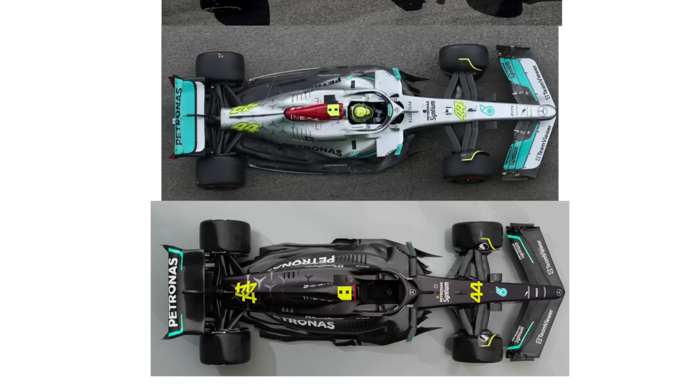So if it's not porpoising, then why is Mercedes fattening out their side pod here? My theory is that it would be for purely aerodynamic reasons. If you imagine that we have a wake off the front tyre and we push it out with all our devices at the front — pushing it out here — that wake will eventually work its way backwards and it will get drawn in if you draw the bodywork in. If we have the wake out here and we pull in the bodywork in this region, we've reduced the amount of volume that's holding the wake out and this will pull the wake trajectory in. So by holding this out for longer along here, we should keep the wake out for longer and then put it in a more favourable position further rearwards. This is a philosophy we've seen on a number of teams' cars, notably Ferrari, where they have that really big bit that goes out for a while and then pulls in at the back. I don't think this really changes the philosophy on the car — it's just a slight design tweak.